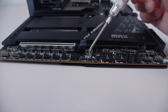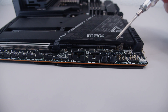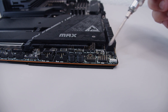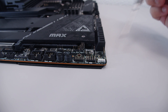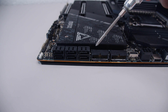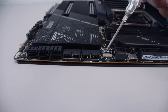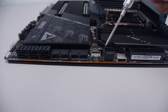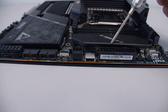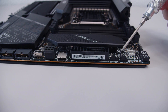There's an RGB switch so you can turn it off, and a BIOS switch because it's got dual BIOS. There are also two USB 2.0 front panel headers for RGB controllers and whatnot, a reset button, a power button, and the connectors for your front panel lights and switches, plus a 3-pin 5-volt addressable RGB header. On the right-hand edge of the board, there are six SATA ports, two right-angle USB 3.2 Type-A headers, a USB Type-C front panel header, a PCIe power connector to send extra juice to the slots, a right-angle USB Type-C front panel header, and the 24-pin power connector.